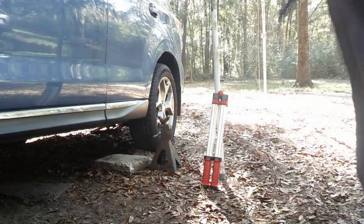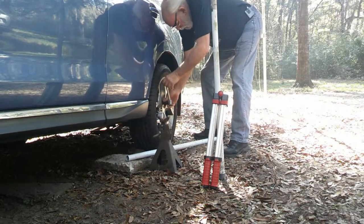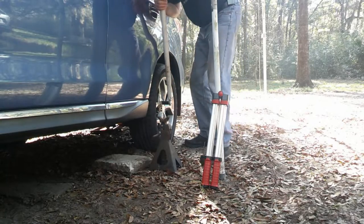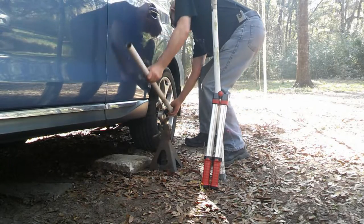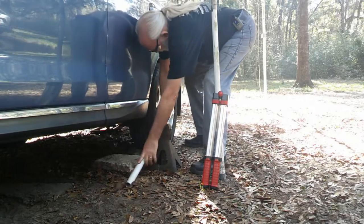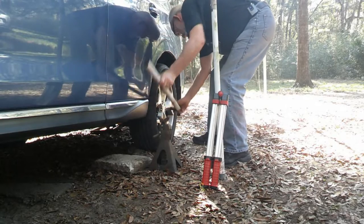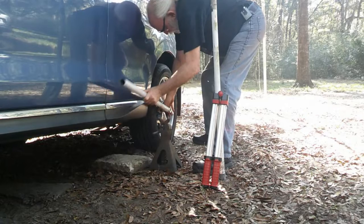I'm going to put you on the side stand, loosen up some wheels, and I'll move you back in. We'll watch how this thing jacks up. So hang on while we go on the tripod. On the wheel — excellent. So we want to just loosen them. I'm trying to get them off right now. We'll loosen them up before we jack it up, because they might not like it once I get off the ground — it might want to slip and slide a little bit. You should put them on in the star pattern. I take them off in the star pattern also.